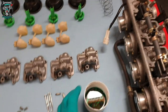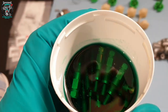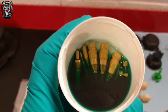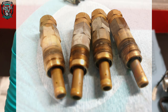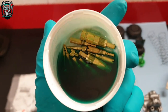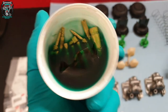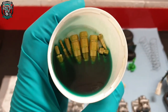These jets I've left to show you — normally they just get rinsed off, but it's fairly nasty stuff, you really don't want to get it on your skin, so you've got to be suited and booted when you use it. These jets went in all green and furry as you saw, and now they're shiny brass. This chemical has completely dissolved all the stale fuel. You just rinse them off with brake cleaner and they're as clean as they can possibly be. I've managed to clean carbs that even failed in an ultrasonic cleaner with this stuff — it's incredible.